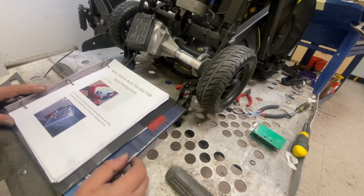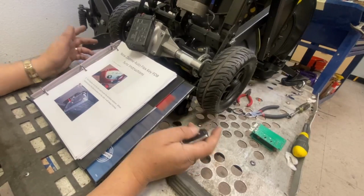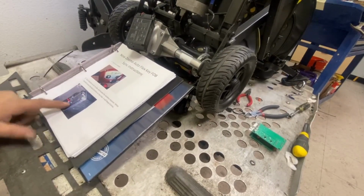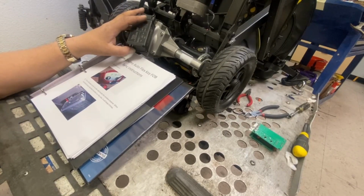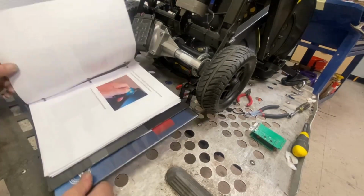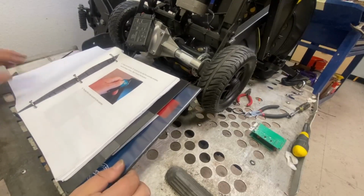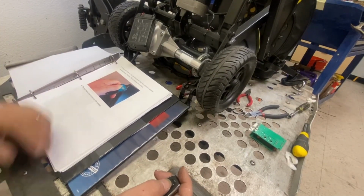Okay, so this is for the Drive Zoomy Autoflex. Same scooter, same controller box. So it says here, turn the scooter on this side, and so on. Press the button, it'll beep four times. So press and hold the A button on the key fob until the receiver beeps three times, then release the button.